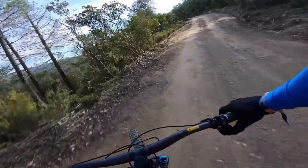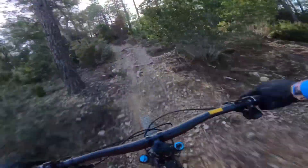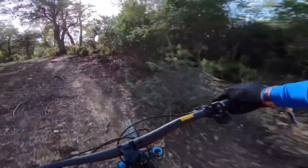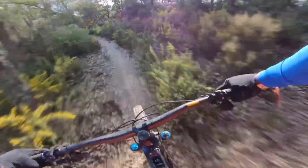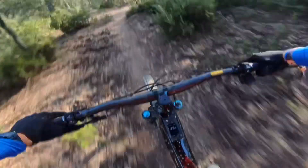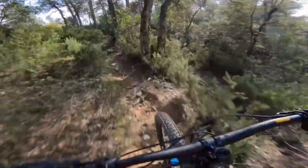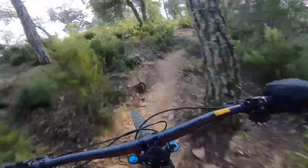I'm going to take advantage of this climb. On the issue of engine noise — pushing it to the limit, you can clearly say it's not louder than any other engine on the market. I would classify it among the quiet ones. The suspension system is really very well designed; the entire kinematics of the bike work in unison. The Magura brakes give you extra stopping power. The bike has good anti-squat and proper anti-dive, so when you accelerate, everything accelerates as a whole. It's a lot of fun — I have a blast with it.